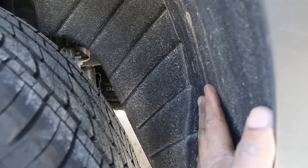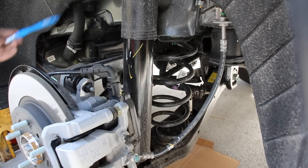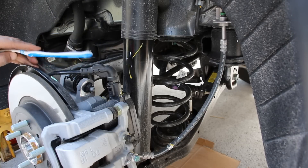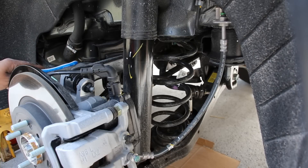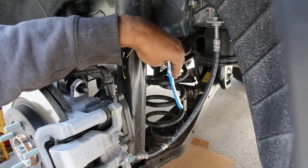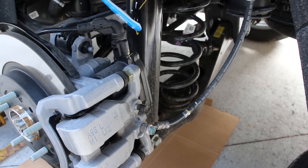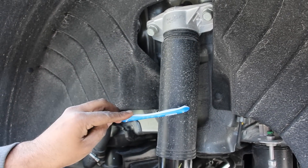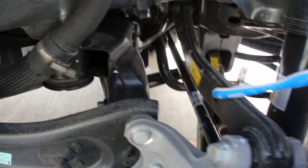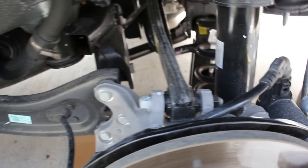Taking a look at the rear suspension on the Hyundai Palisade, you can see a multi-link setup at the back. That's going to be good for handling purposes, but probably not as solid for off-road or towing purposes like a solid axle design — but let's be honest, that's not really what this vehicle is meant for. All of these components are made of a stamped steel design, which is a bit of a cost cutting measure over aluminum components. The rear lower control arm has three different mounting points: one for your stabilizer link, one where the coil spring sits, and one where the shock absorber sits — all with different motion ratios accounted for in the design. Working on the suspension shouldn't be too difficult — one bolt at the bottom and two bolts at the top, so shock absorbers should be pretty easy to swap out. There's also the trailing arm, the upper control arm, the front lower control arm that ties into the knuckle, and the rear lower control arm — a total of four links making up the suspension.